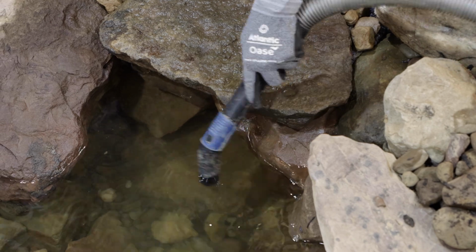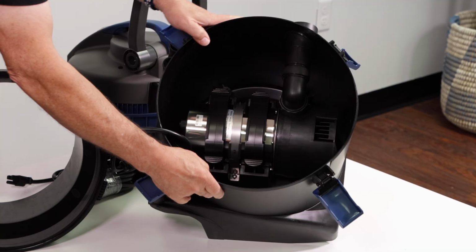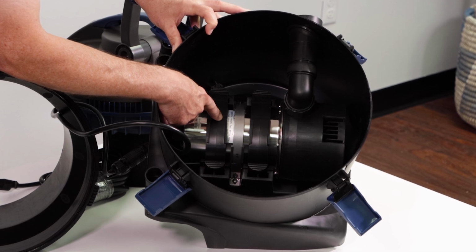The PondoVac can become very heavy during use when filled with water. Remove the suction head from the water and allow the discharge pump to empty the canister before moving the vacuum cleaner. The body and seals will be subjected to excessive strain if the vacuum cleaner is moved when the tank is full.